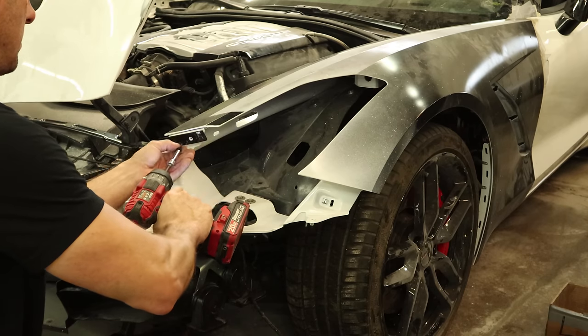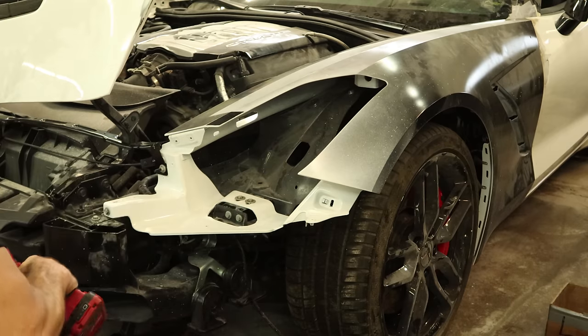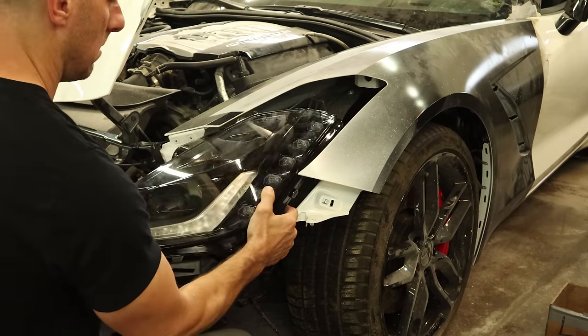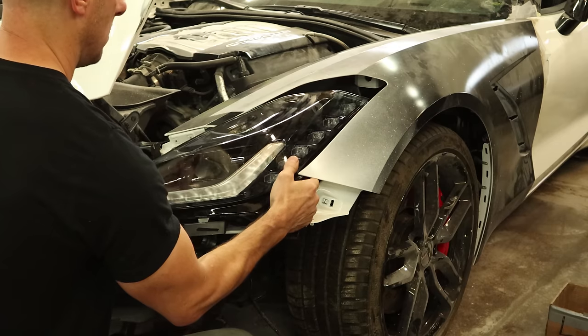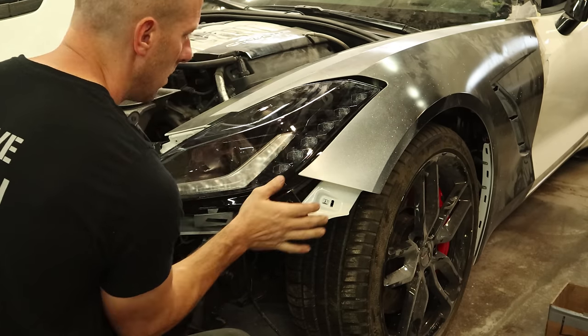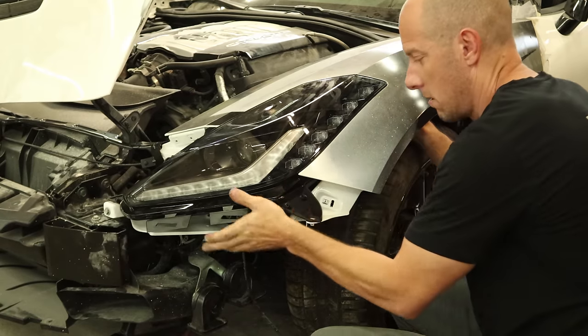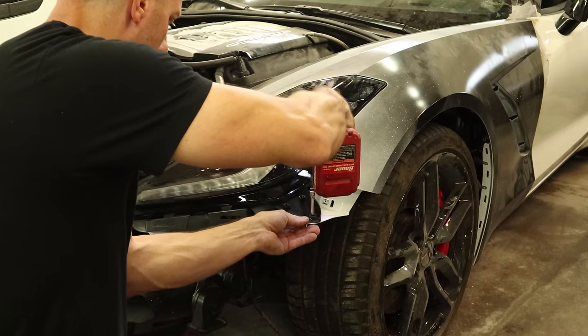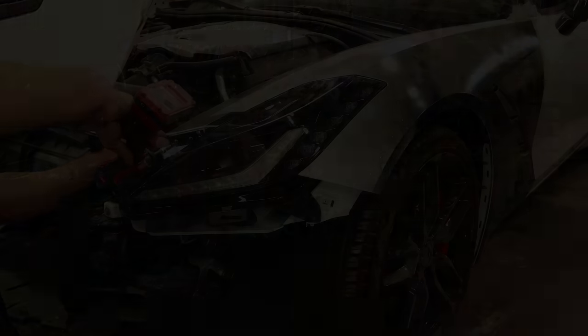I kind of expected more — there still might be more, we're not done yet. It's all part of learning. So now back to something I know how to do. We're going to put the headlight in. Take the little bracket off the end of the fender for the bumper, slide our headlight in, bolt the headlight down, and put our bracket back in.